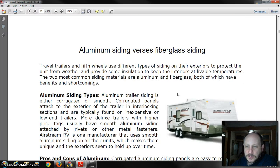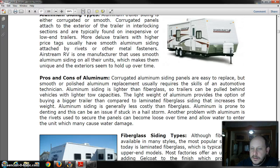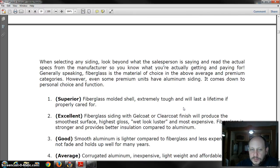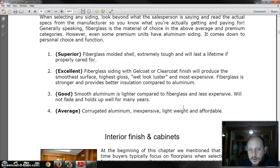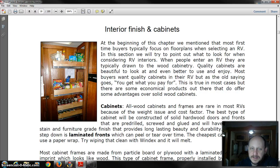You'll get a really sturdy wall. As far as your siding goes, there are two camps — aluminum or fiberglass. I particularly like fiberglass better than aluminum because it usually doesn't leak as much. However, if you've got a rubber roof you've got more work keeping streaks off the side. Aluminum will also ding really badly in a hail storm. Fiberglass is probably superior, and gel coat fiberglass in particular because it's better on your finishes.